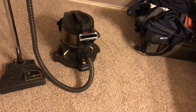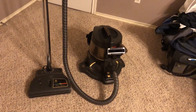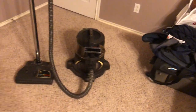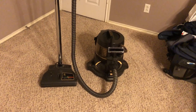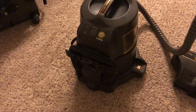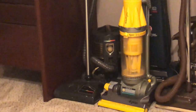And I got that along with a big 14-foot hose that unfortunately was not in the best of condition. And I also got the wet hose that came with it, and luckily it's in pretty good shape. And so what I ended up doing to fix this up was I basically bought a smaller 2.5-quart water basin, put in a brand new separator, and I also did have to replace the back cover because one of the cord ears was broken off. So I got this from another parts machine that's actually sitting right over there, and I robbed the back cover off it.